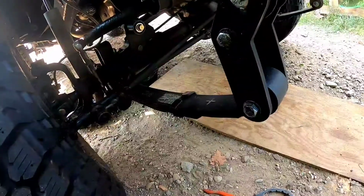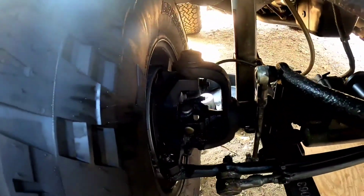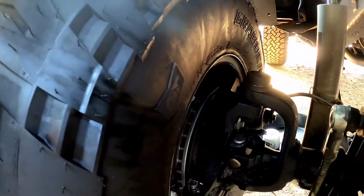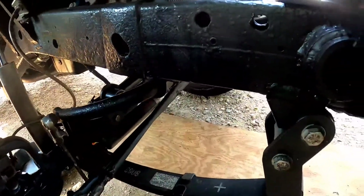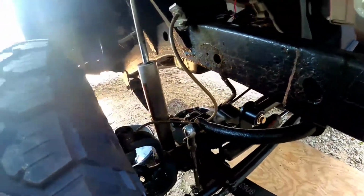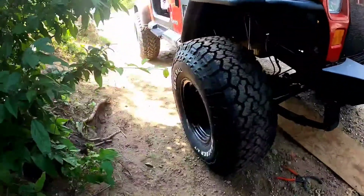We did four and a half, right? Yeah, 4.5-inch Rough Country lift. All new U-joints. All new brake setup. We had to patch the frame in several spots, as you can see. And we POR-15'd the whole thing. And then after that was all done, we did NH undercoating. 35s on it.